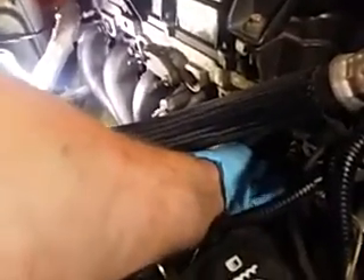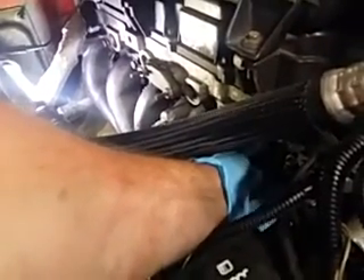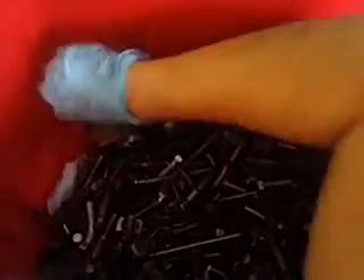Long story short, just gonna make sure all the bolts are back in here. We put never-seize on all of them just to prevent it in case you have to go back, though hopefully we never have to. I know this bolt isn't right. They said 120,000 miles with the warranty — or I think the guy said 10 years — but this is 160,000 miles. This is the junk box for all different bolts, matching it up with the grooves. Anyway, obviously this is a Chevy Trailblazer.